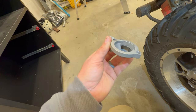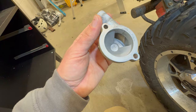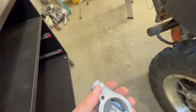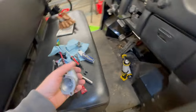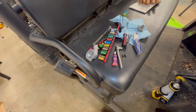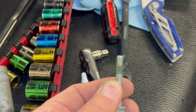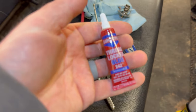Don't be afraid to wash this in water — especially if you get a bunch of little gunk in there, you don't want that in your cooling system. Rinse this out with water; it's fine to have a little bit of water in it. So we're going to put the thermostat in and put the gasket on. I did grab some thread lock because I noticed on the bolts that came out it looks like they did have some kind of thread lock on them — it's pretty deteriorated. I'm using blue removable; doesn't need to be anything insane.